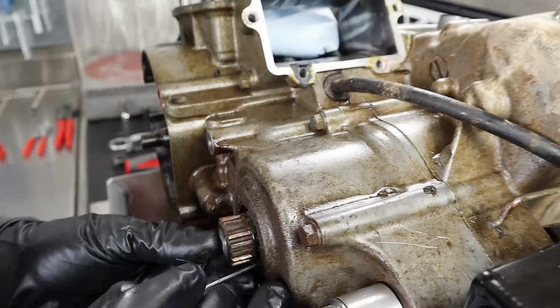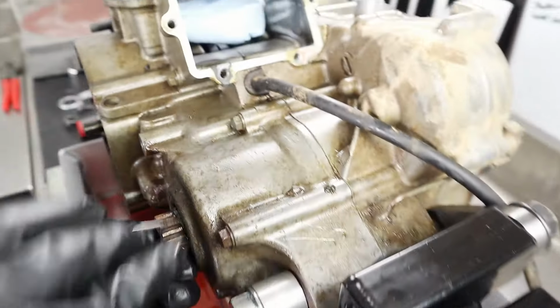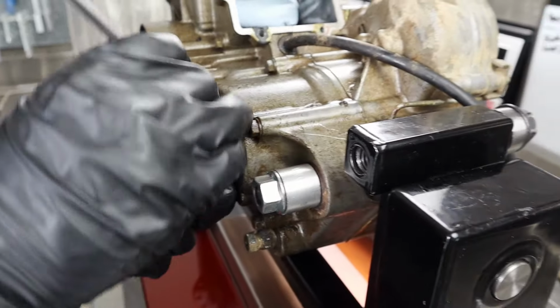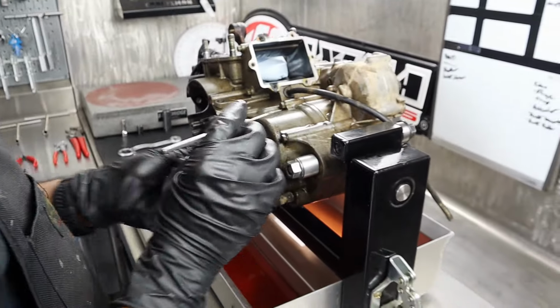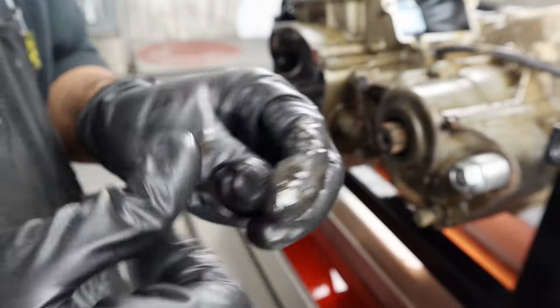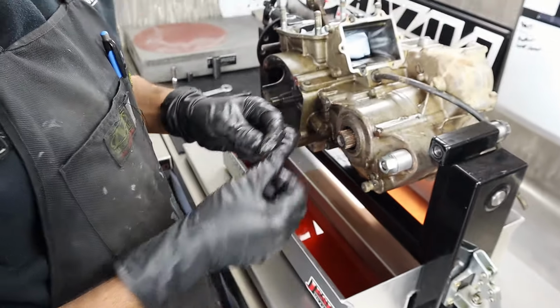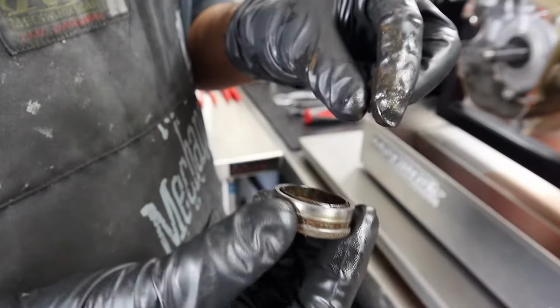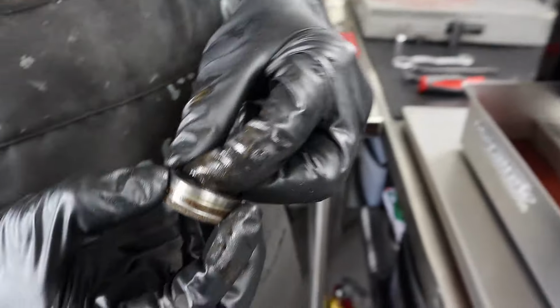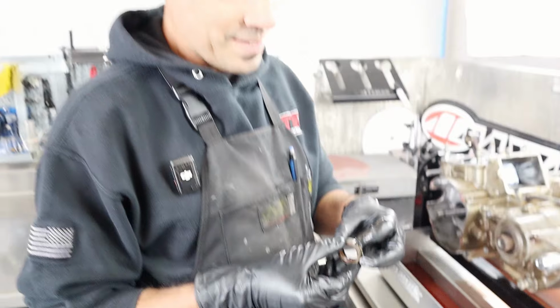There's always a sneaky little D-shaped, well, they call it a D, but it's like a flat O-ring on the Hondas. It goes in front of the countershaft sprocket collar. It looks like this. Yours shouldn't be covered in rusty mud, but this one is. It looks like a D this way, like a half moon, cupped on the top. It sits in this collar on all Hondas and creates a seal. Is there a groove in that collar for it? Yeah, a little shoulder. This one has some grooves, so we're going to have to change it out.